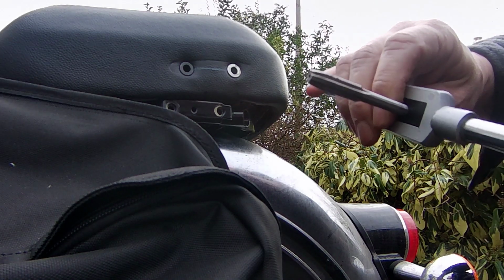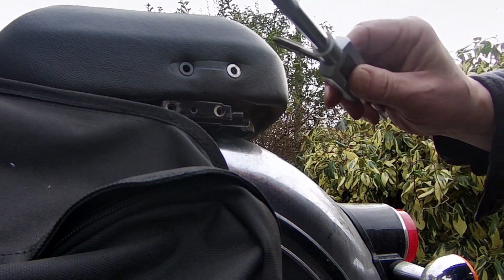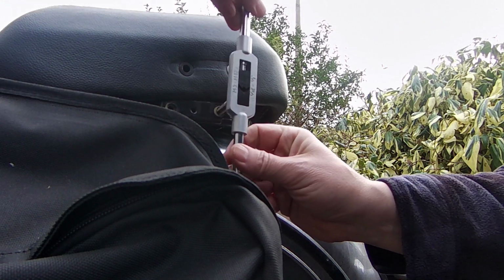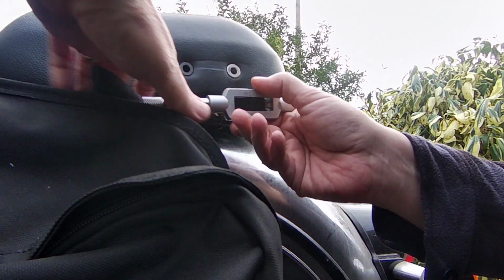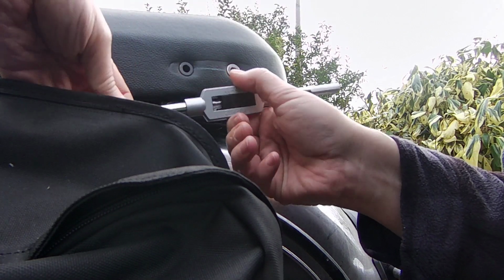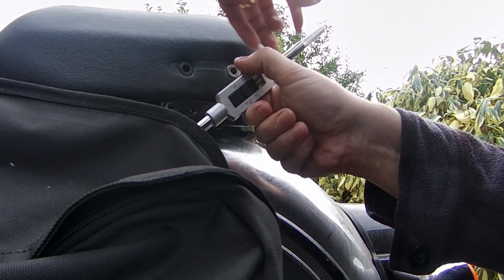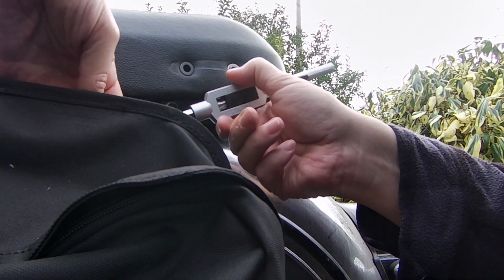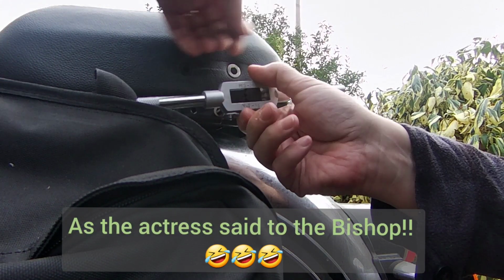and I'll run my tap die set in it. Now I'm not using any sort of lubricant, because what could happen is when you put the new bolts in, the thread lock won't grip properly, so I'm just going in dry. That's it.